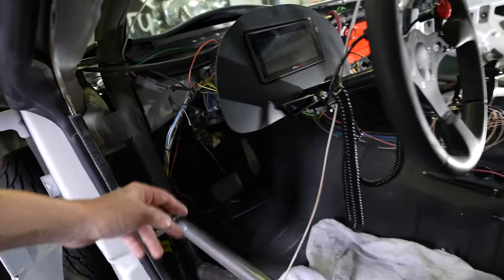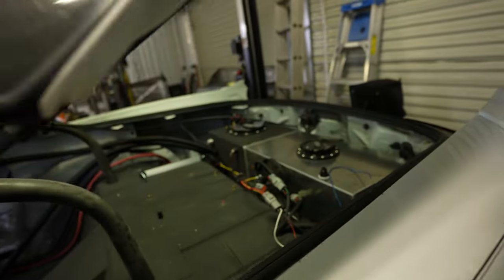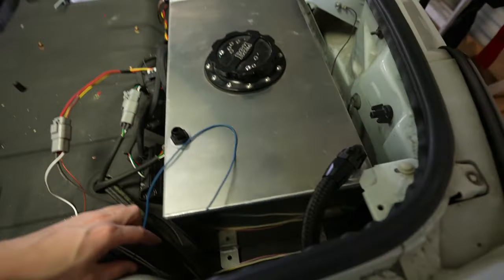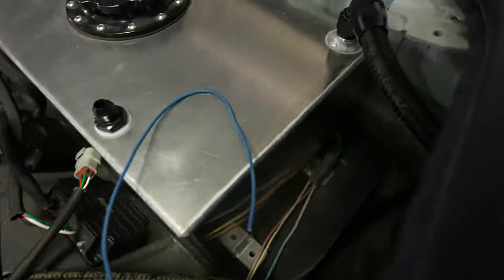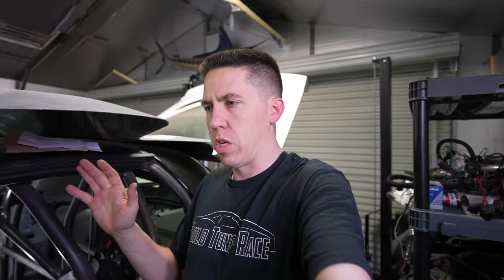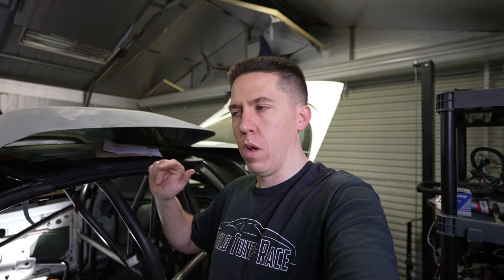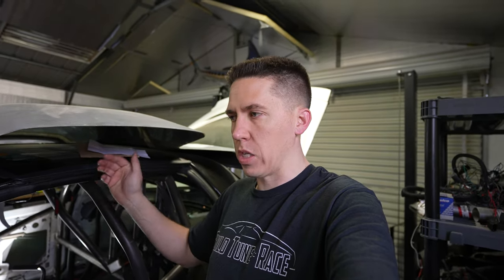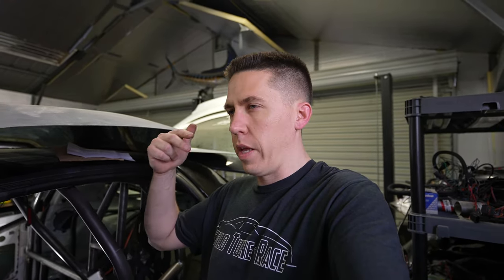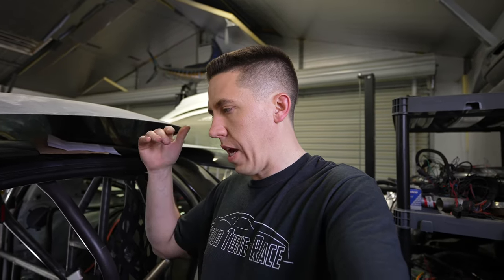AJ came over and has been helping me tie all of it. We used some string and have been tying the main harnesses that run down along the car to make sure everything stays good. That comes back here and we've got Deutsch connectors all over the place — Deutsch connectors for the fuel pumps. We also have a Deutsch back here for the body harness for all the headlights and tail lights. Something weird on this: there was no low beam wire, just high beam wires. It has a three-wire plug — constant, blinker, and ground.